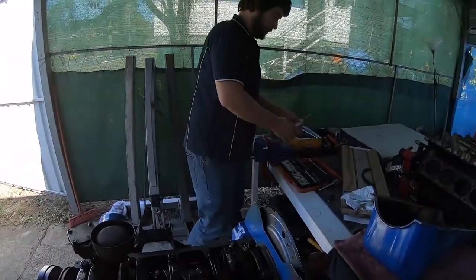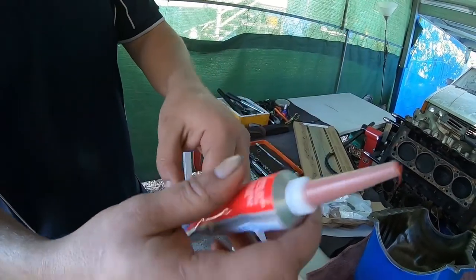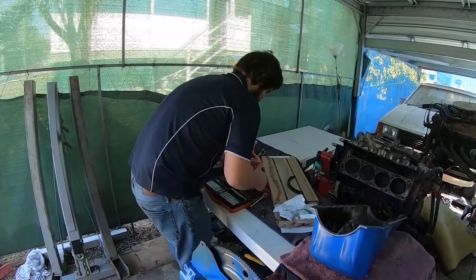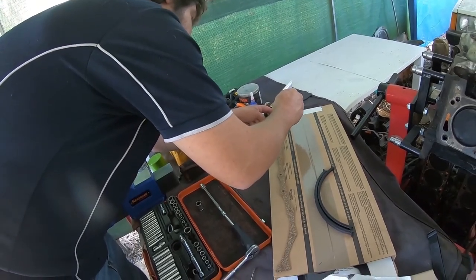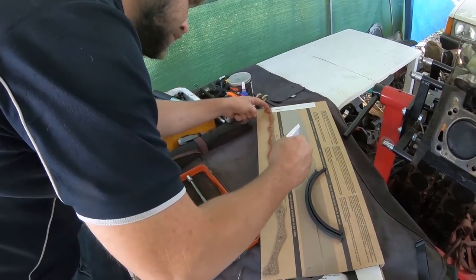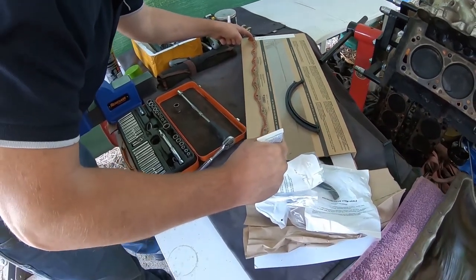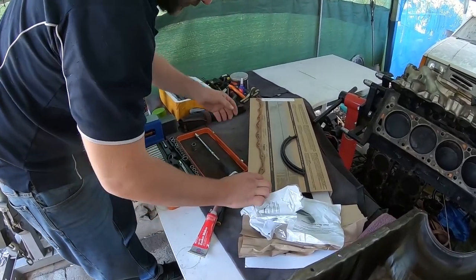I laid the gasket out on the pan, picked it up and flipped it 180. I showed in a previous tip how you can flip the lid around and put it in — this has been over 24 hours now and it's still ready to go. Just wipe the lid clean and then put a nice neat bead on this gasket. I like to squeeze the tube from the back forward so you don't run out of pressure halfway through a line — I like to roll the tube up.